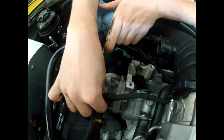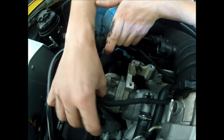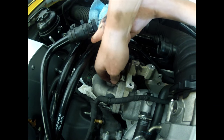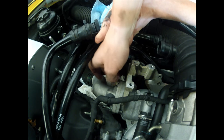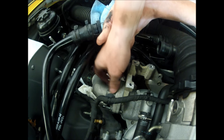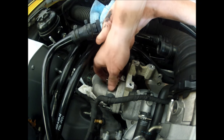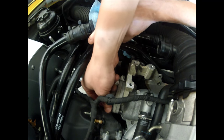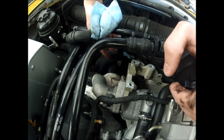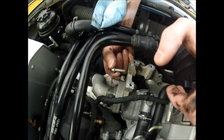With the electrical connectors it's very easy to pop these off — if needed use a screwdriver, but you don't have to move the actual wiring harness itself, just get it out of the way so you can work around it. These right here are thirteen-millimeter nuts that are part of the studs, so when you take them out it all comes out very easily. The two on top are these thirteen-millimeter studs; they hide an eight-millimeter bolt at the bottom which you'll see right in the center.